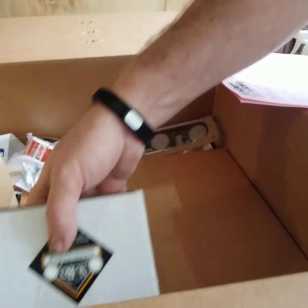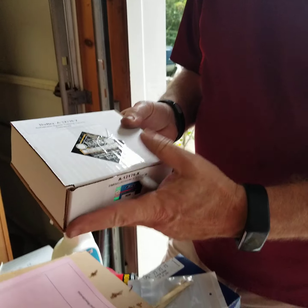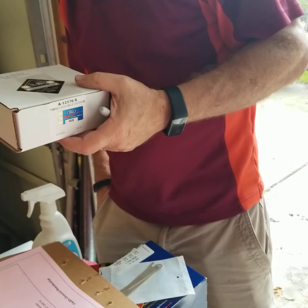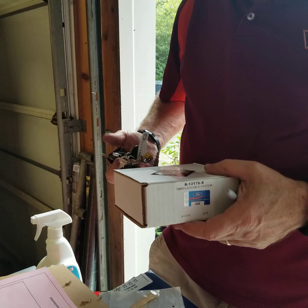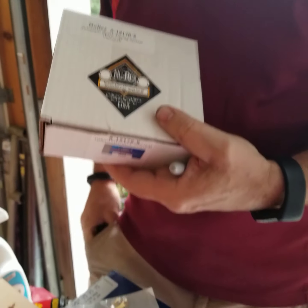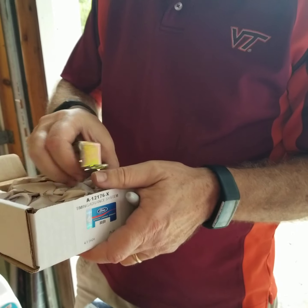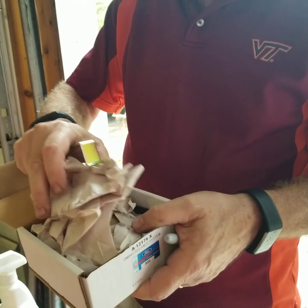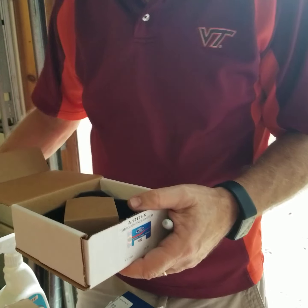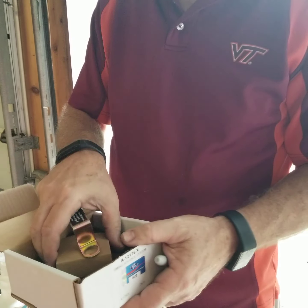All right, what this is, it's made by a company called Nurex, and it's actually an automatic spark advance. The Model A's were designed with a manual spark advance, which is different than most modern cars. Most modern cars have automatic spark advance. So this is actually a kit, designed with a special little device, and it's part of the shaft that goes to the distributor.